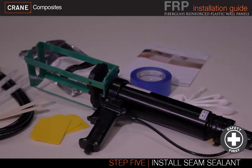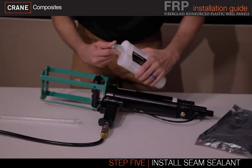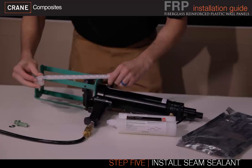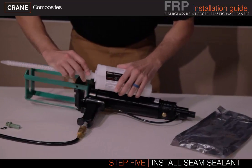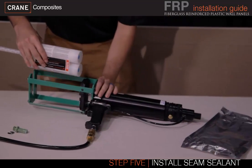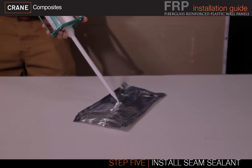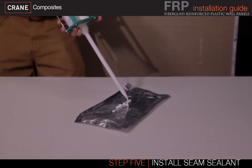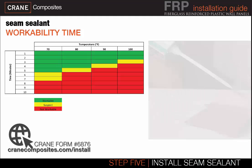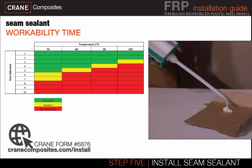Safety is important — wear glasses, gloves, and protective clothing, as sealant may stain clothes, walls, or floors. Prepare the seam sealant by removing the plastic nut from the outlet end and the metal retaining clip. Load the cartridge into the dispensing gun, ensuring that the plungers are lined up properly. To ensure the sealant is mixed and dispensed at the proper ratio, the plungers need to be level. Slowly advance the plungers until a small amount of material is equally dispensed, then add the mixing tip and dispense a small bead of material. The seam sealant has an approximate open time of 3 to 5 minutes, and application must be completed within 3 minutes of the initial purge. New tips will need to be used if the sealant exceeds the open time.